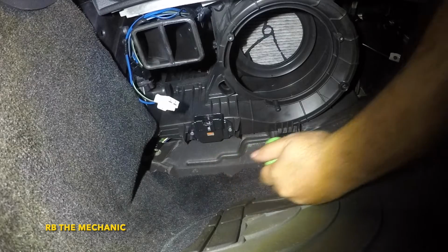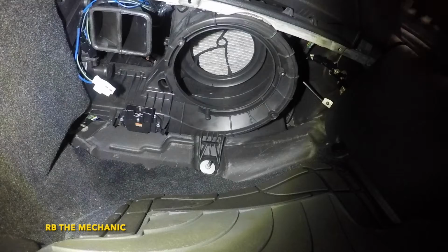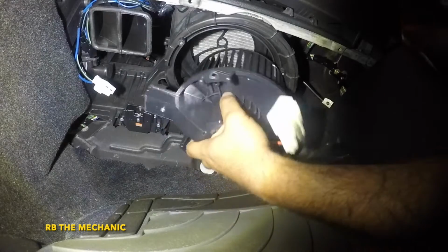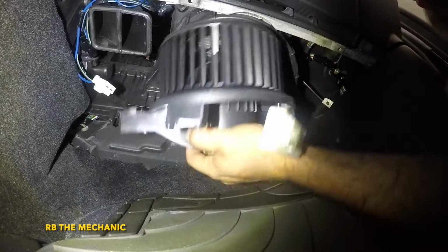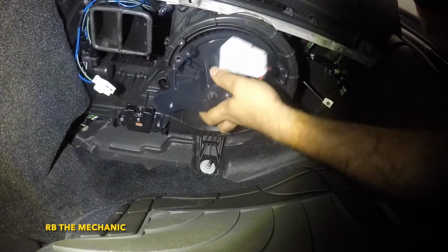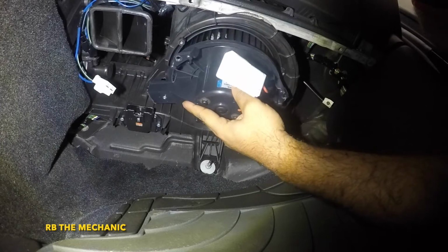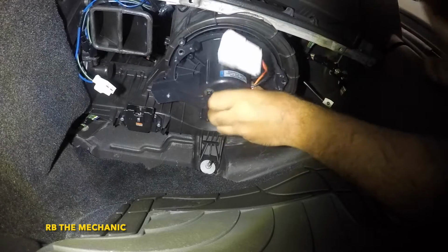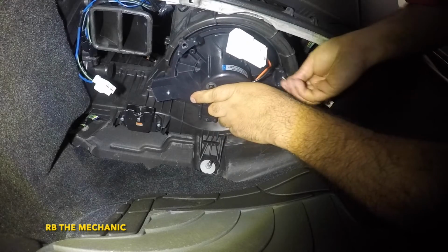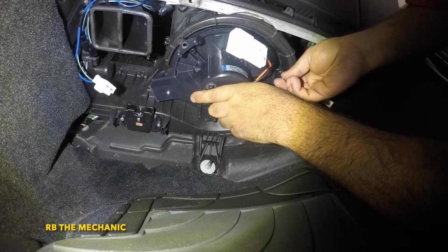Okay, we're gonna come over to the blower motor next. Okay, we got our blower motor. Remember, the blower motor, this vent here goes right there to suck all the fumes or whatever from the motor. So it lines up simply just like that. Okay, can't go wrong there. So now, reverse procedure, I like to put the easiest one in first. That way it holds for me.